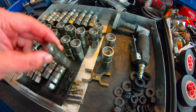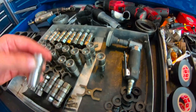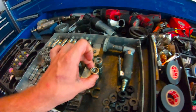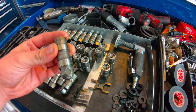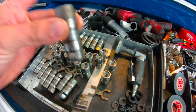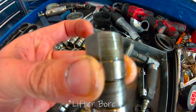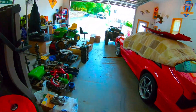You might ask why you can't just slap the stock rollers in place of the flat tappets. The length difference is going to cause a bunch of trouble. I've heard of people using them, but it's not worth the damage — when it comes up out of the lifter hole it might stick on the edge and you start breaking things, so it's better to do it the right way.